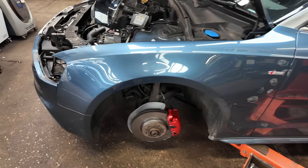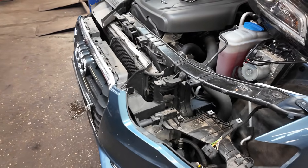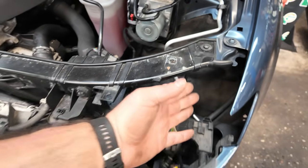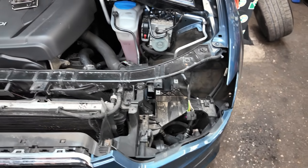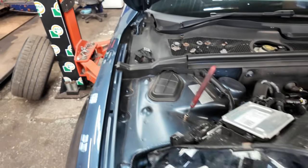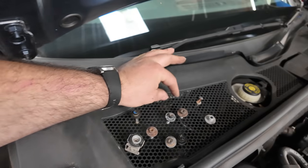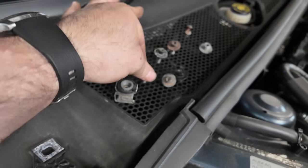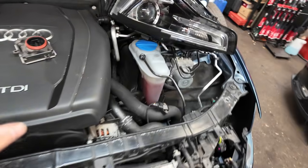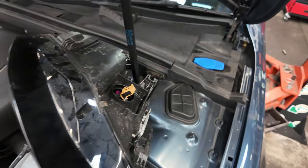After a bit of fiddling, it was an absolutely pointless exercise taking the front wheels off because there's nothing accessible from the inner wheel arch at the bottom. The headlights themselves pull out through the front, which involves lots of little screws. One thing I like about these Audis — bolt storage. Look at that, perfect. The LED modules themselves are on the bottom side of the headlight.